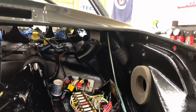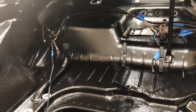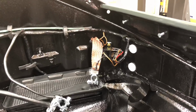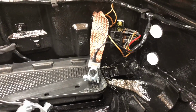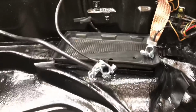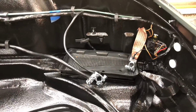That's 50 millimeter hose, and that's real tight, getting those in there. We'll go over that here in a little bit. Also, that's where our fresh air block-offs will be going. And then one other area we're going to go over in great detail. I don't know if we'll be able to cover it in this video, but this whole area here where the windshield wiper bottle goes, the horn relay, we've got the windshield wiper motor squirter that's going to go down in there. Also our battery. Everything here is so tight for space. I've actually had to rework all this. I pulled out my original battery tray, relocated it, and I'll show you exactly what the problem is with that area. Okay, let's go ahead and get started with our lid here and see how that goes.